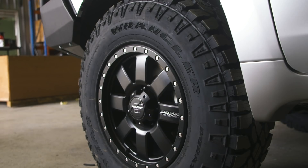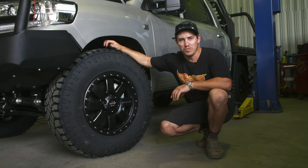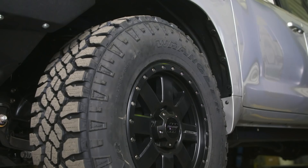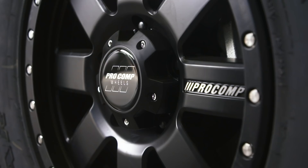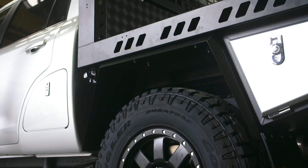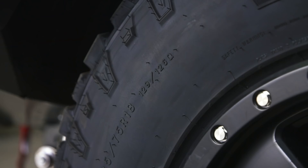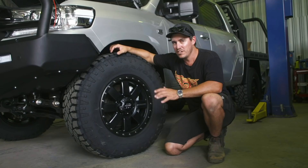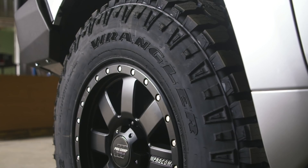Let's have a look at the tyres and wheels on the vehicle. When it comes to picking tyres and wheels for a build like this, you go by what tyres you want and the look of wheels you want. But on a vehicle like this, they need a specific load rating because the GVM is just about four and a half tonnes. The wheels are Pro-com Biodynamic - they're awesome, satin black, and they've got a load rating of 1,500 kilos. The tyres are the Wrangler Duratrax. The load rating is 129, which equates to about 1,800 kilos - so they're over-engineered for this vehicle. They've also got a speed rating of Q, which is about 160km/h.